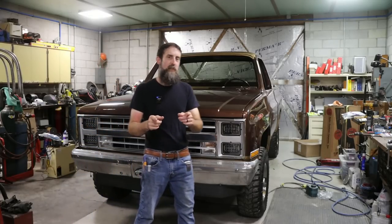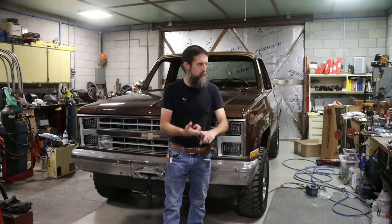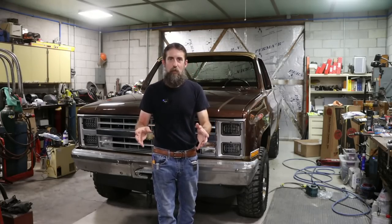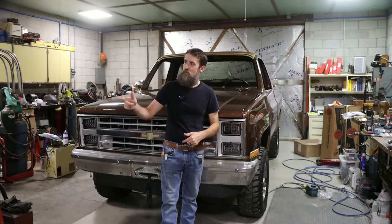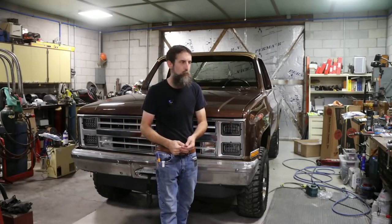Simple video this week — taking it easy, to be honest. Super pleased with the way that rust-proofing works. Love the FluidFilm — I'm not affiliated with them whatsoever, I bought all that stuff just like anybody else. I like that it's a lot less prone to run out and drip from the panels like motor oil would, and it's not like rubberized undercoating that holds moisture and can make your rust issues worse. I've seen that before. FluidFilm gets a big thumbs up from me. The spray gun, although not industrial, did the trick.